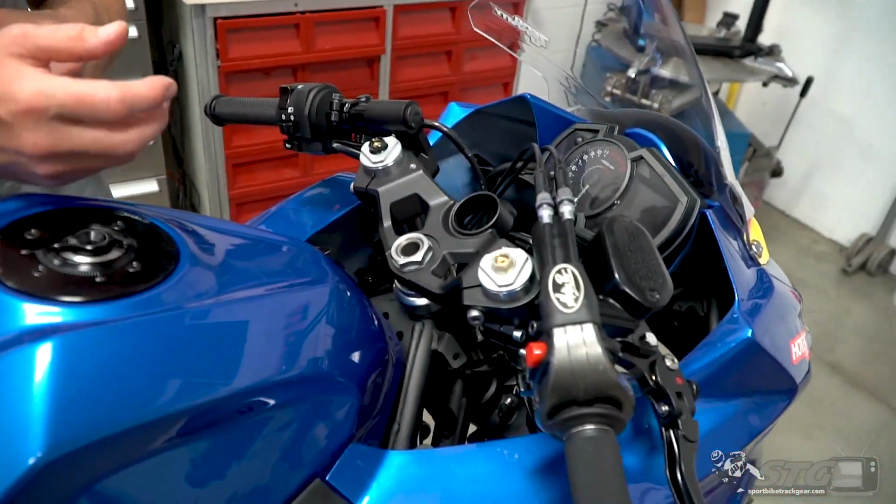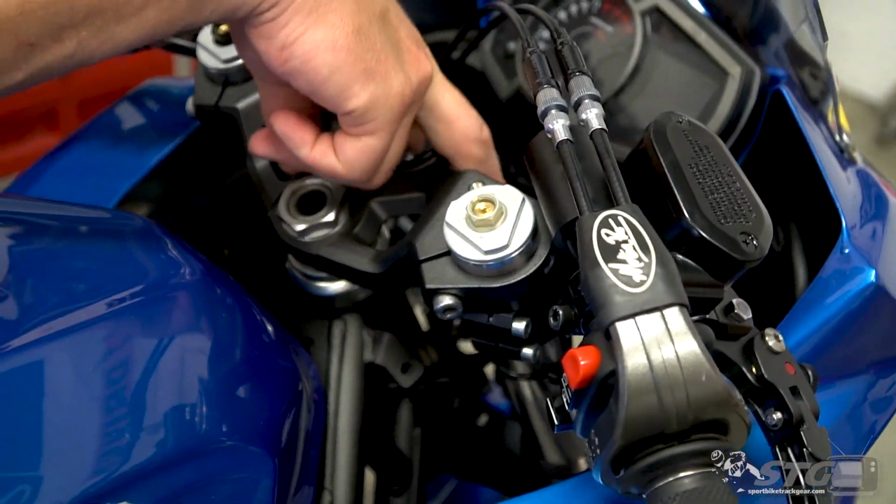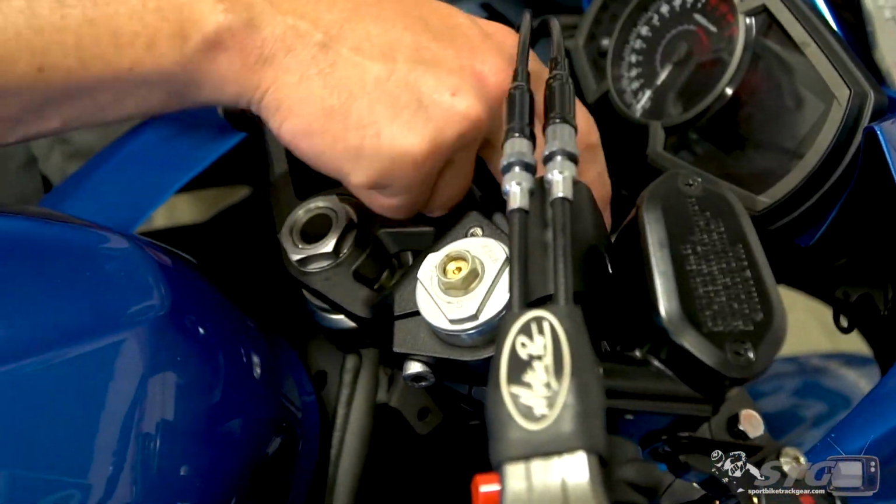In this video, we're going to show you footage of what it takes to get this dialed in. Just the cliff notes. You need to be able to pull the top triple clamp. You got to drill out two breakaway anti-theft bolts that hold that key switch cylinder in there, okay? You have to be able to do that.